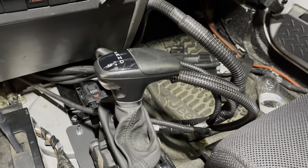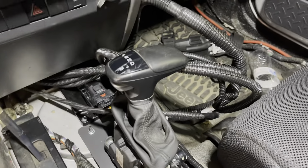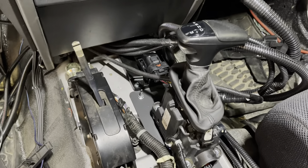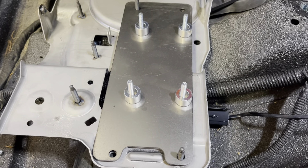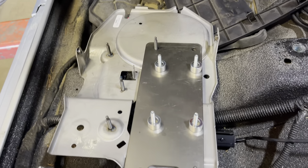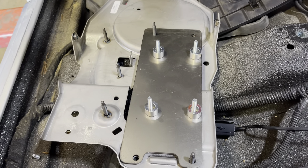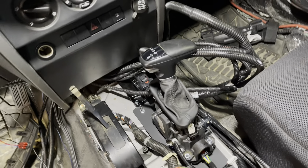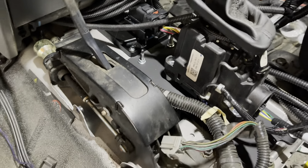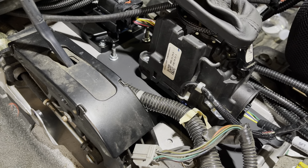So this is how it all goes. I've had a few people ask me questions, so I'm doing a quick video on how you mount the shifter plate to the sled — I gave you the part number for that. Also, if you have a stick shift you're going to need to reprogram the Jeep as an automatic, because if you don't, all of the warning lights will be on the dash.